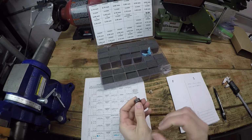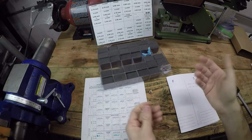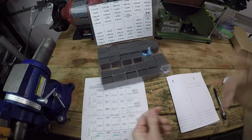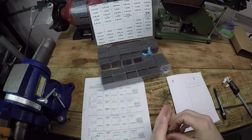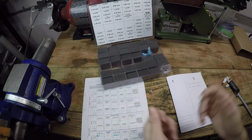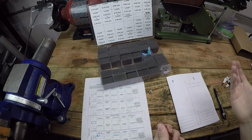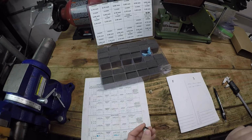So the valve clearance on this particular closer is a little bit strange because the gap was too large. It was larger than the Ducati specified clearance. I measured the clearance at 0.178 millimeters, and the maximum clearance allowed is 0.1 millimeters. So it's not common that you find a valve that's looser. Usually they're tighter. I didn't see any abnormal wear on any of the camshafts or anything like that, so I think it was just maybe misadjusted in the past. Maybe they didn't have the correct size shim, so instead of keeping it on a smaller range, they just put in a shim that made the gap larger rather than smaller. Who knows? But anyway, we're going to try to get this dialed in.